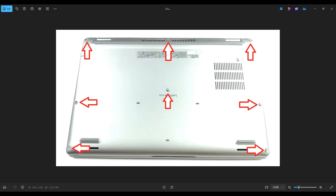It's generally better to start back here near the hinge assemblies in each corner. And once you start in one end, if you get stuck, leave it — start in the other direction and continue from there. Also, try not to put your pry tool too far in; you could damage some internal components. Just keep it on the edge, be slow but firm, and you'll be able to get that bottom case off.